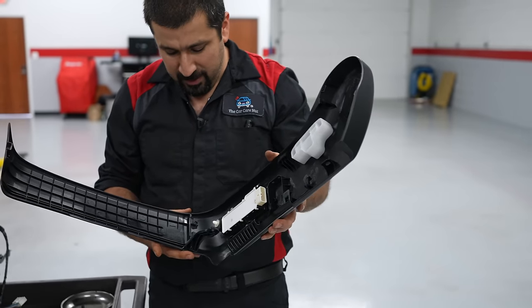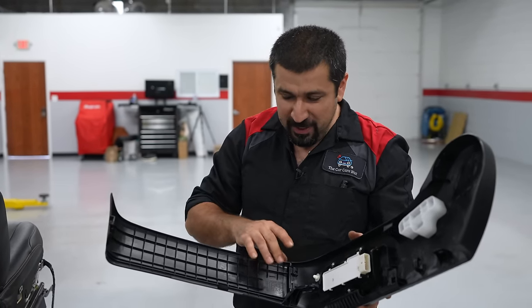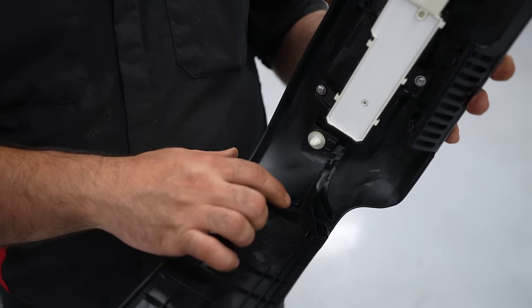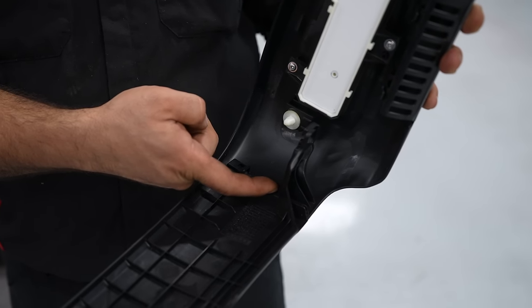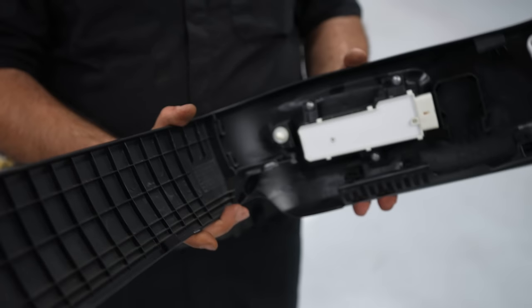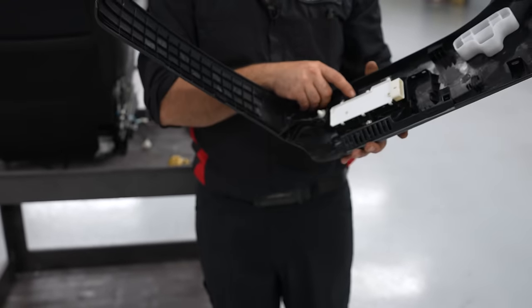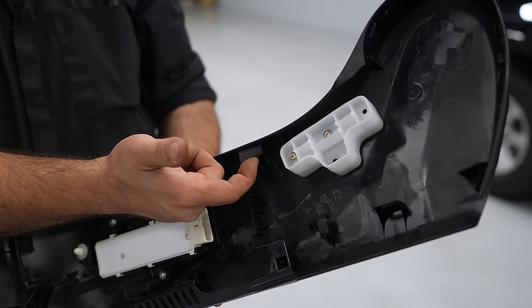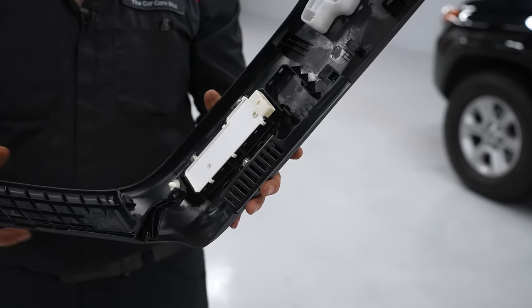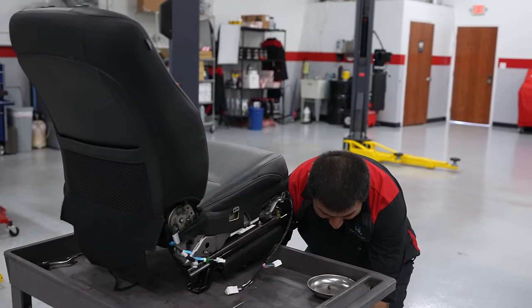This is the side cover. Usually at a dealership, when you get to this magnificent sight and nothing broke, it's a very happy moment. The reason I told you not to remove this ever is because of these clips. Do you see how this slides into these? As soon as you put something to pry this up, it will get mangled and it'll never go back — it'll just keep popping every time you sit. Be very gentle. You have clips here and you have these hooks. I can move this with my hand — this doesn't take much to break. You break this ear right here and every time you sit in the seat this just falls off. This is why you have to be really careful. When you spend the most time on this, trust me, everything else is nuts and bolts.